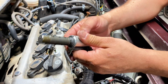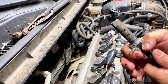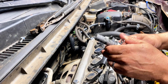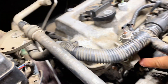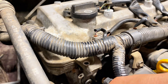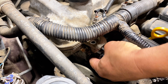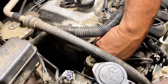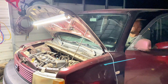Oil level is full but this was just a cheapo no-name one, and that's my fault - I should have got a better one. Some may say to use Toyota, but this Dorman brand does me pretty good. Look at that hole - there it is, right next to the timing chain. I'll slide this in, face it the right way, push - it went in. Line up the bolt, reinstall the bolt to the sensor, hook everything back up, and then we're going to give it a try. Hopefully this engine will run the way it's supposed to.